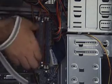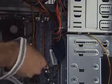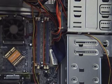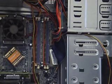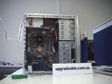The memory can be checked that it's seated properly by gently pushing down on the memory module. If the memory doesn't fit, don't force it. In this example, only the left-hand module is installed correctly — the white latch on the left has clipped down the module, but the one on the right hasn't.